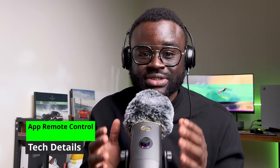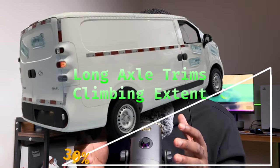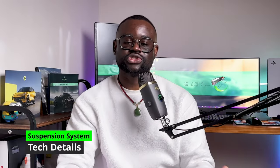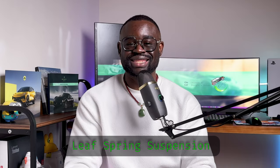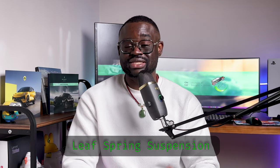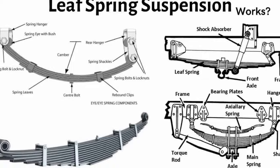The Dana app on your phone connects via Bluetooth to the van and uses the hotspot to provide features like internet, map navigation, and voice interaction. The maximum climbing grade differs by trim: short axle trims have a maximum grade of 25%, while long axle trims achieve 30%. For suspension, the front uses a MacPherson independent suspension system and the rear uses a leaf spring suspension, which is popular in heavy-duty applications like vans.